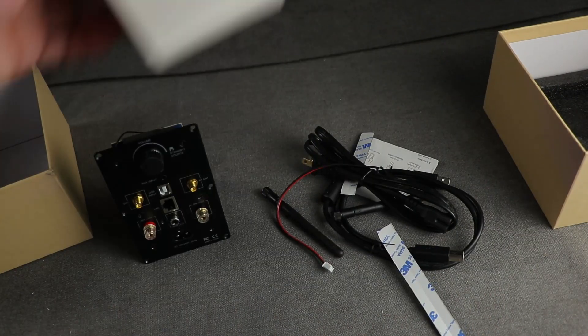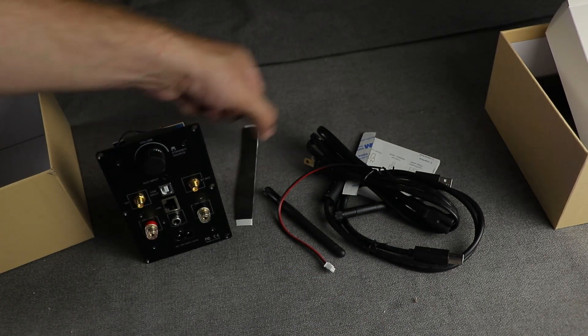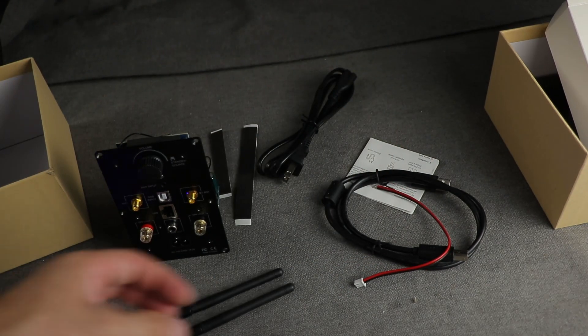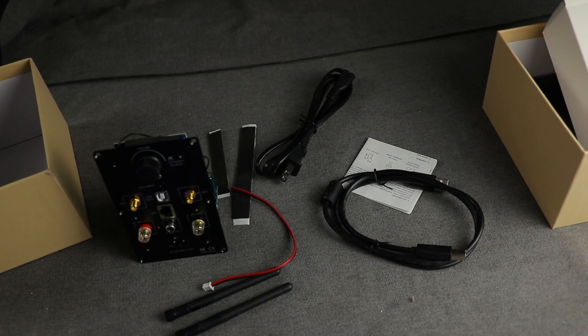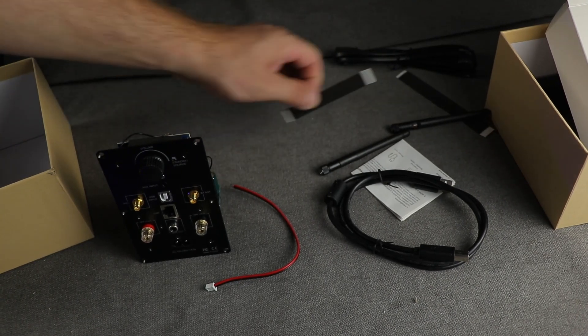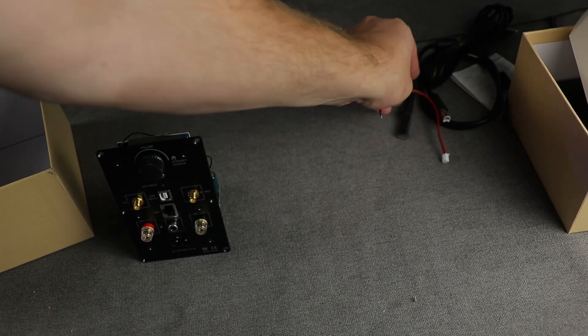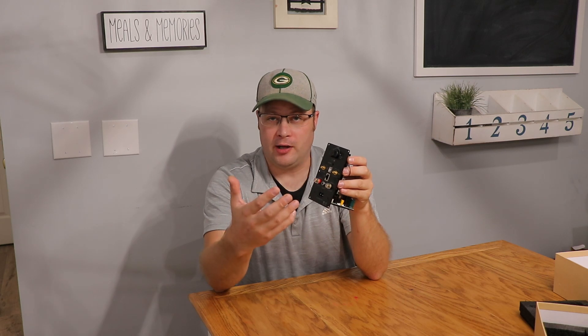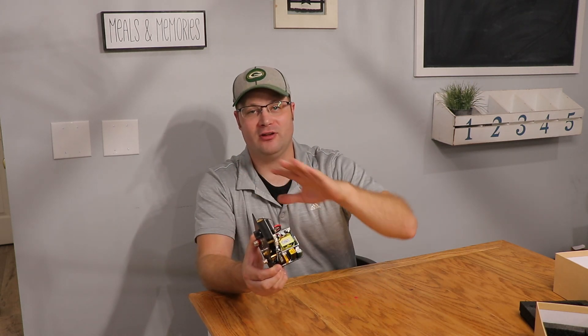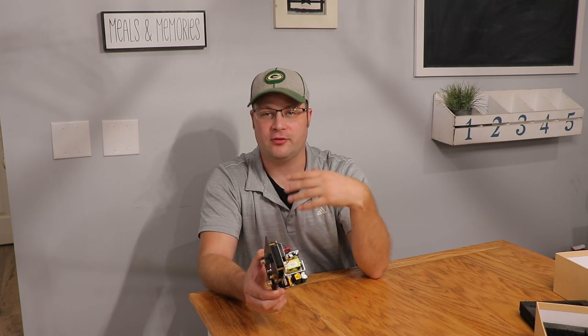It's going to be 2x40 watts at 4 ohm and 2x20 watts at 8 ohm. So it's not as high powered as some other amplifiers, but it'll be plenty fine for a small sitting area with 4 ohm speakers or even a desktop setup. I could even see this used for a soundbar, especially with that subwoofer out — your wattage goes a lot further in that scenario. A lot of people might use this as a DIYer with some bookshelf speakers for a computer, a soundbar, or a small boombox.